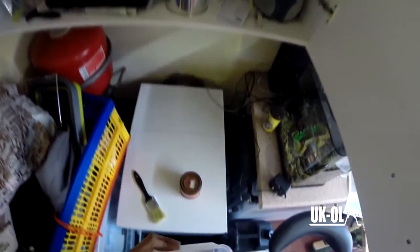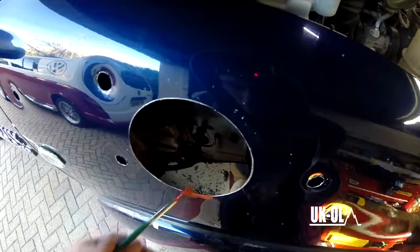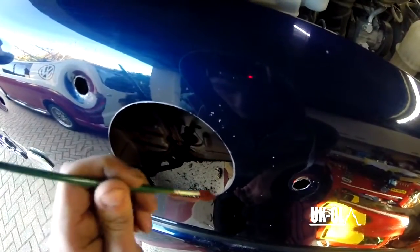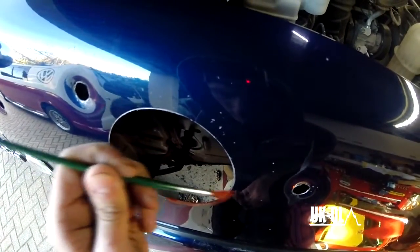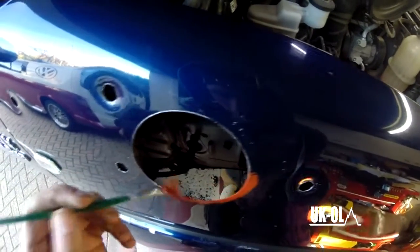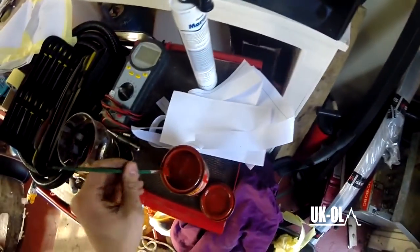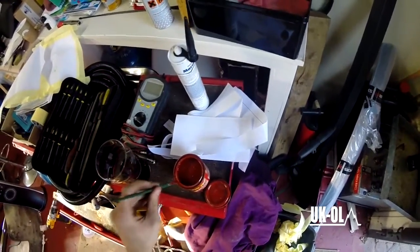And now you need to paint every bare surface that you've drilled. I used red oxide. This paint doesn't have to match the colour of the car at all, because all of it's going to be underneath the Snorkel body anyway. Some people like to spray it the same colour. Either way, I think you should use red oxide primer, which is what I'm putting on here, before you put on the top coat, because top coat hasn't really got the rust protecting properties.